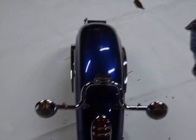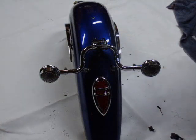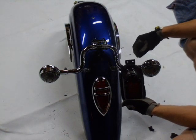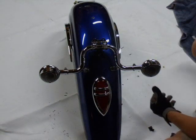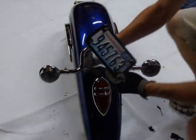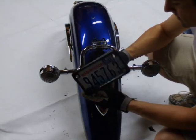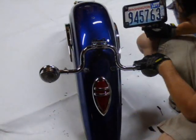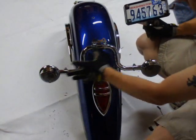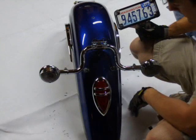We're going to get that back on the bike tonight, but we have another problem. The old tail light had a mount for the license plate. This one, being for a car, obviously doesn't have that. So I needed to get a side-mount plate. I used a Baron bracket and I've started to mount the license plate to it. That's going to mount on the side now instead of in the back, cleaning up this whole area as well. I can't wait to get the new signals on there — the new signals are about that big — and it'll remove all of this, cleaning this whole rear fender up. Once I have that, I can fill in all the holes with fiberglass and then have the rear fender repainted.